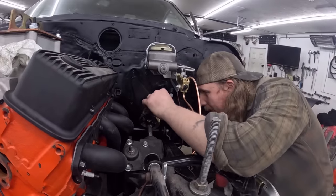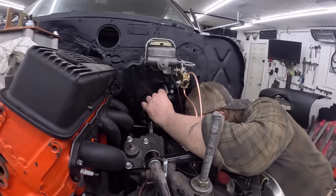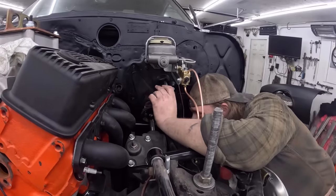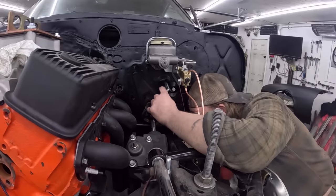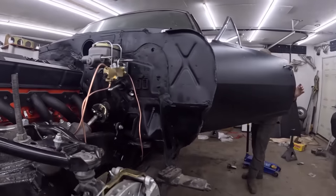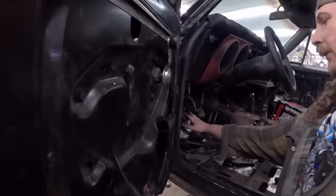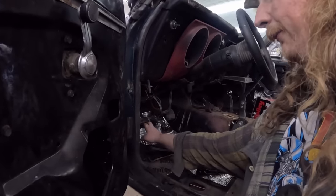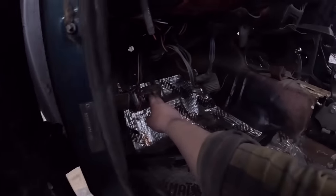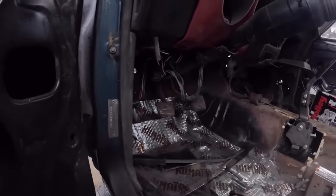You're happy? Well, I will say that this linkage fits a lot better when the bearing is in the proper location. Who would have thought? So, how's that? That should probably be pretty close to in the ballpark. Now, if we come around here, the clutch pedal is just down a little bit from the brake, which is kind of common. And so we have a fair bit of play before it starts doing anything. So that's where we're actually grabbing the clutch. So we need to put more adjustment in, and then we'll lock her all down.